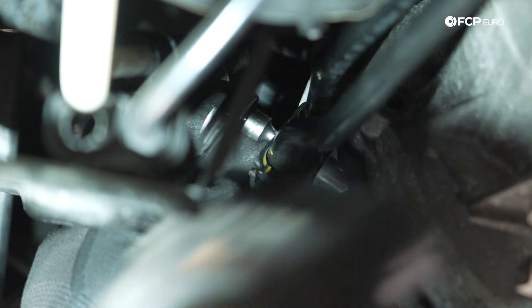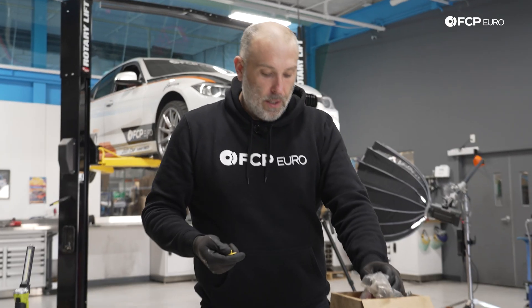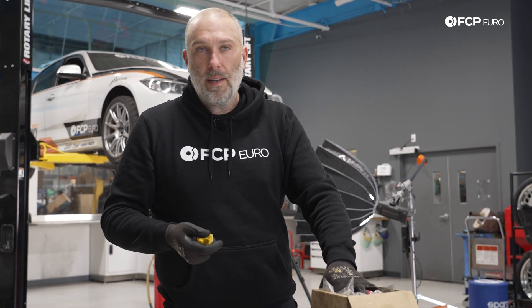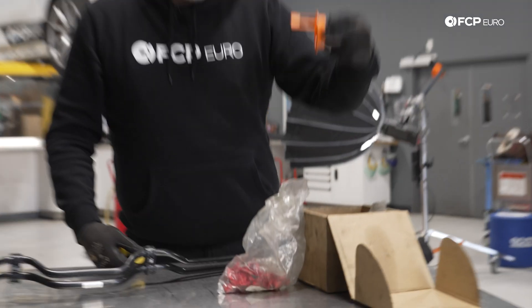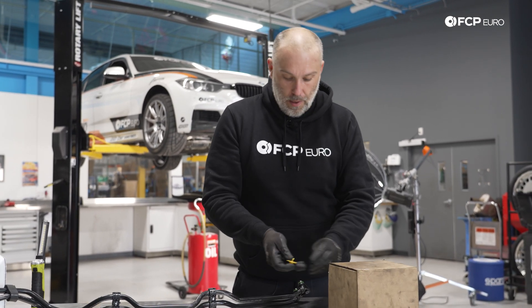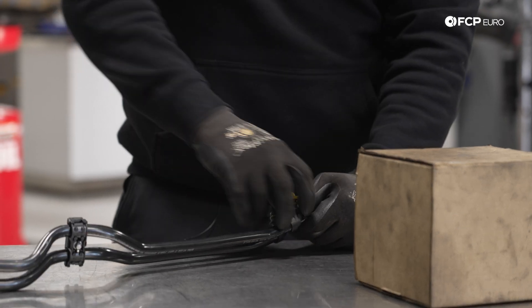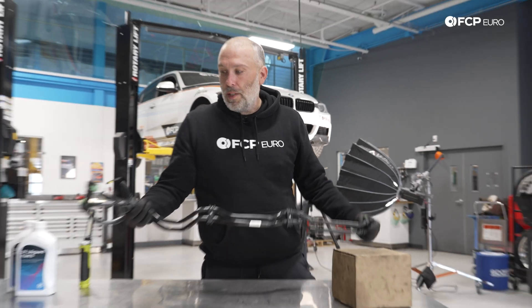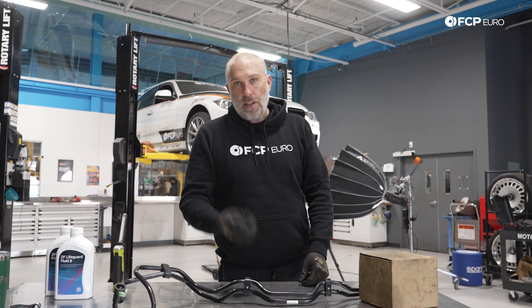The new lines come with their own hardware, but I actually find that T30 screws with the internal drive are much easier to work with as opposed to the E8s they provide. It's just an M6 thread, nothing too special. I'm a big fan of blocking off sensitive things like your transmission cooler ports. My piece of advice: all the parts you buy that have lines and couplers, you're going to get plugs — just put them in a box and hoard them, because there will come a time where you need them. I found two that perfectly fit on the trans end, so I'm going to plug the transmission, lower it down, disconnect the trans cooler lines from the trans cooler, and slide the whole assembly out. This is a really nice design because it's flexible, making it much easier than E-chassis cars, which are a nightmare.